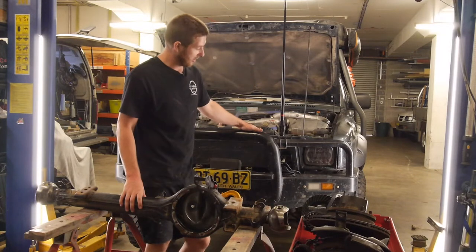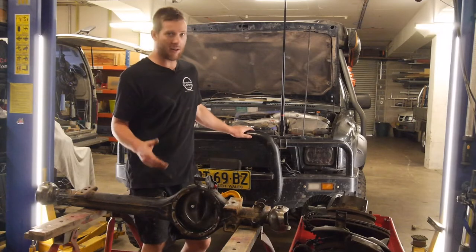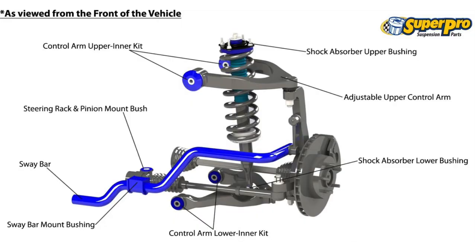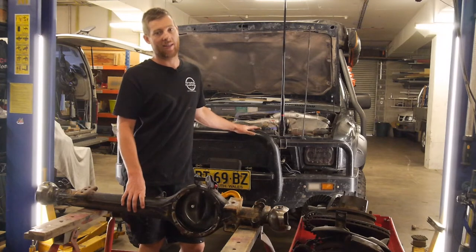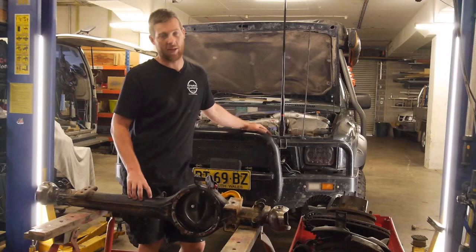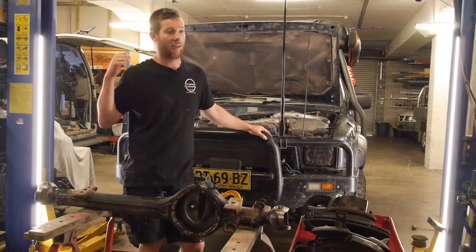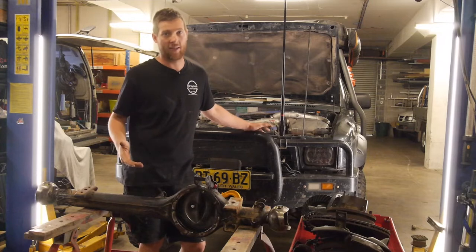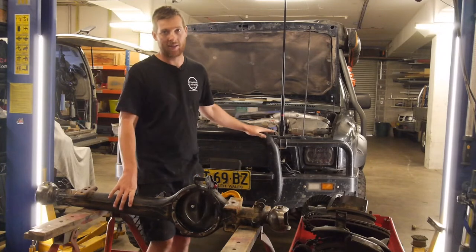The main question a lot of you might be asking: why are you swapping to a solid front axle? So on these N60 Hiluxes, the front independent suspension is a torsion bar setup. The next generation N70 Hiluxes came out with a coilover front which works a lot better, but it still has its limitations. For serious four-wheel driving and articulation, you can't beat the solid front axle. This torsion bar setup is fine for, say, my van — I'm not trying to flex that thing. But for off-road, trying to get wheel travel and articulation, it's just been garbage.